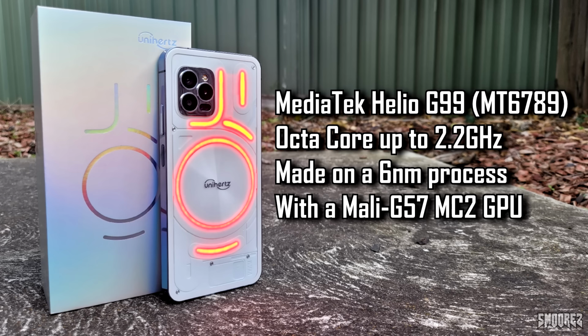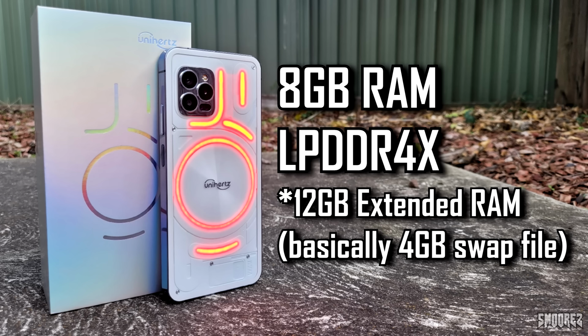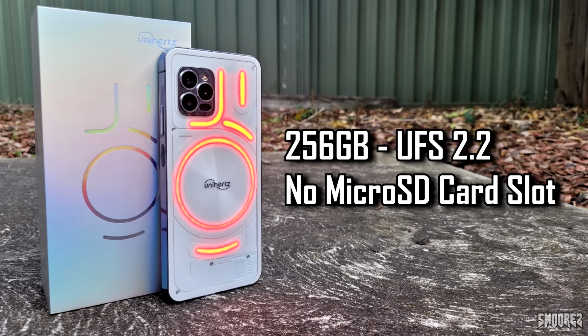The system on chip is the MediaTek Helio G99, which is the MT6789, and I like that, 6789, and it is based on a 6 nanometer manufacturing process, and this is an octa-core processor with a turbo frequency of 2.2 gigahertz. The GPU in this is a Mali G57 MC2 GPU, so we will see how this goes with gaming. RAM is 8GB of LPDDR4X. However, in the listings, it shows it to be 12GB, which isn't quite true. It's 8GB of onboard RAM, but you can have up to 4GB of additional virtual RAM for multitasking. I've personally used this on other devices, and I see no difference, but maybe that's just me. Storage-wise, we have 256GB onboard with no microSD card slot.